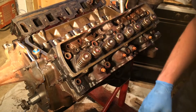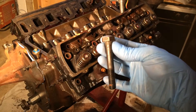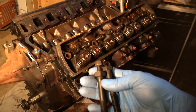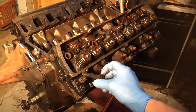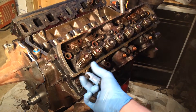Now that you have it set on there, just go ahead and grab your head bolts. There are shorter ones and longer ones. Now these two shorter ones — notice this one has a stud with a nut on top. This one goes right here, because that's where a ground strap goes. The shorter ones go on this front lower corner and this rear lower corner. The longer ones are every other one — the rest of them. Just something to note.